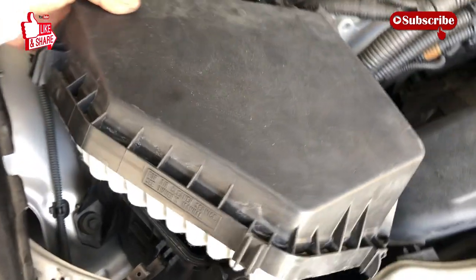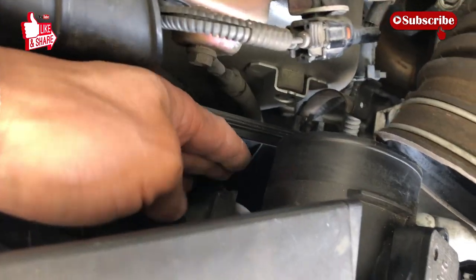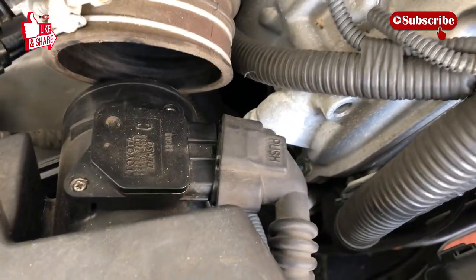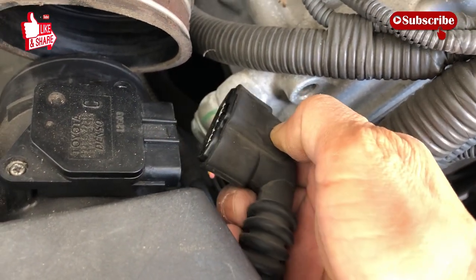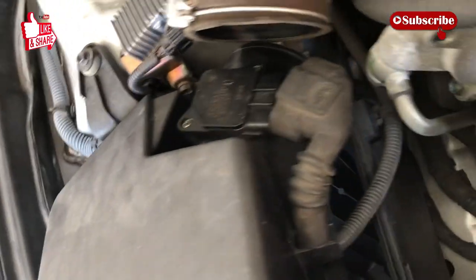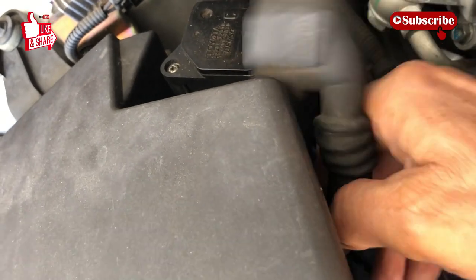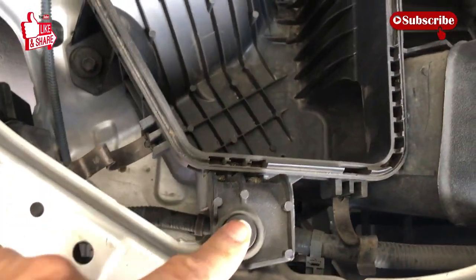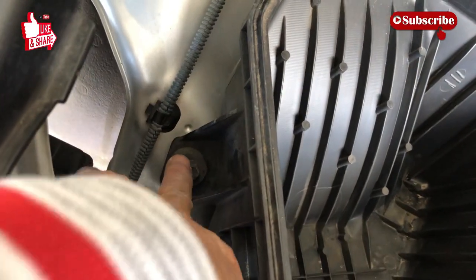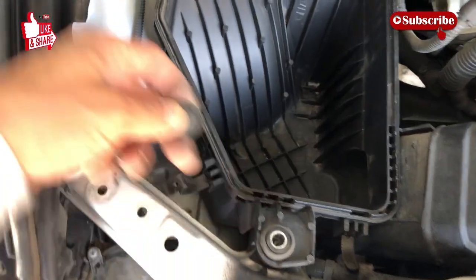To get more access, we're going to have to remove the air filter box. There are four clips — one, two, three, and one in the back — pop those off. This is the mass airflow sensor, so press down here and pull it out. Loosen this clamp a little bit with a 10 millimeter. There's also a clip on the side holding the mass airflow sensor cable, just pull that out. You can then remove the top part of the air filter box. We already loosened one bolt but it looks like we need to loosen another one — note that the long bolt came off from down there.